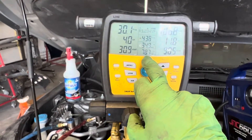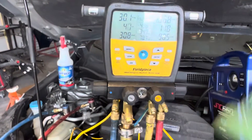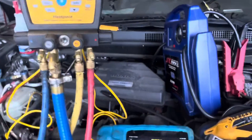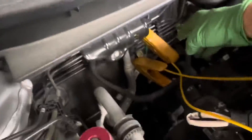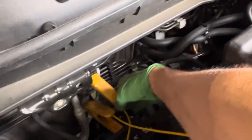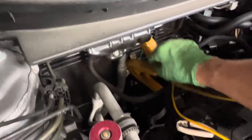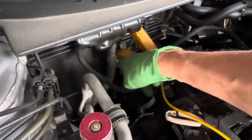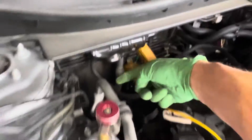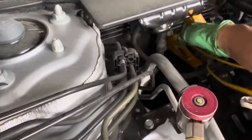Our liquid line temperature is 78 degrees. Remember, it's 65 degrees outside right now. I'm taking the suction line temperature right out of the evaporator. For subcooling, it's actually getting sub-cooled through the cool liquid going through the internal heat exchanger. Over here on the other side — it's a cool day, so it probably won't make a big difference. About 10 degrees subcooling.